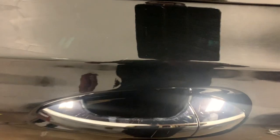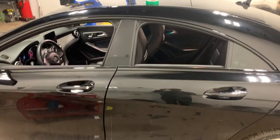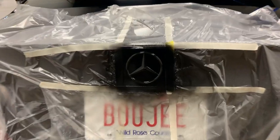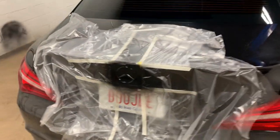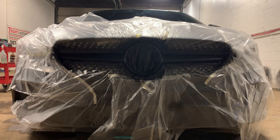There is some chrome on the back but you can't really see it honestly, unless you really poke your head down below at a weird angle. Before, with the chrome, you could see all the scratches — and now it's all gloss black. Looks fresh, looks clean. I'm going to do the other side — obviously not going to film it since it's the same process. I'm going to do the handles, continue spraying the grill, and the rear emblem. We got some gloss down on the rear emblem — we used black Plasti Dip and Glossifier. I was going to use Piano Black Hyper Dip but I didn't have any in stock. We're going to be spraying the 2K gloss on the grill now, and then on the front emblem. We're going to do one light coat followed by a solid heavy coat, then let it sit in the heat overnight and come back tomorrow.